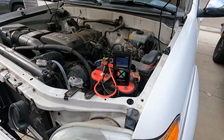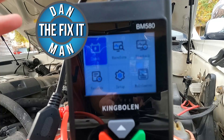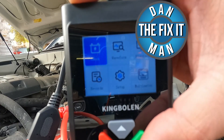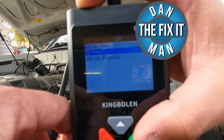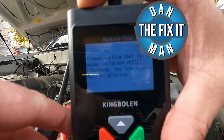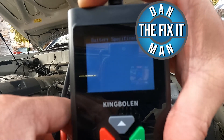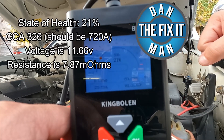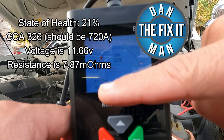So let's get it hooked up. I'm going to bring you down closer because this screen is just very, very dim. I went into settings and I changed the theme to a white background because the dark background was even worse. I also went into settings and turned off the beep function — that was somewhat annoying. Let's go ahead and hit the okay button and scroll down to 12 volts. Now this has got a quick test, in vehicle or out of vehicle, so we'll do an in-vehicle test. Right now we're going to do the battery test, but you can also see we have a charging test, startup test, and a load test. Battery test first, just to see where we're at. Confirm that the engine is turned off. It's also asking me what type of battery — this one is an AGM spiral, cold cranking amps is 720. So just hit okay. And there you can see our state of health is 21%. It's saying that it's time for a replacement. Cold cranking amps is at 326, voltage is at 11.66, and resistance is 7.87.